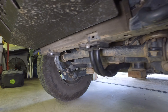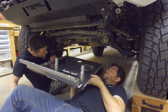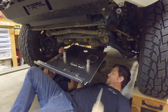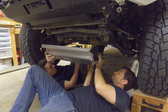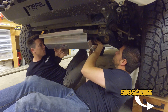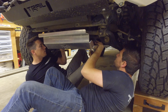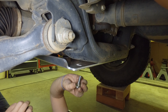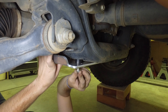When you pull off the stock skid plate, you have these tube supports — that's where one of the bolts is going to go in right here. We're going to start with the middle bolts, the ones that go up to the cross member — those are just the normal brass bolts provided. I'll need that long extension for this. The way you install the nylon lock is to put the bolt with the washer up through the skid plate, add the nylon lock up to the top, and then screw it right up into the cross member.